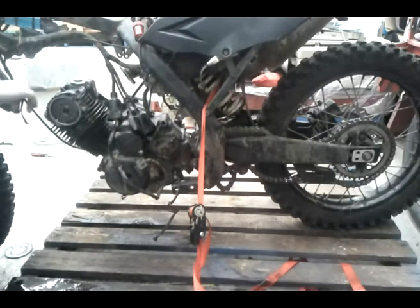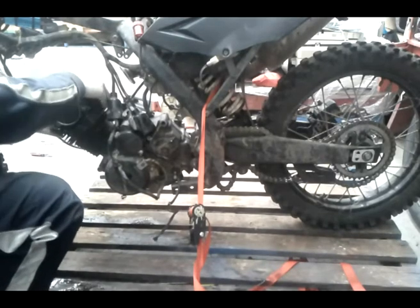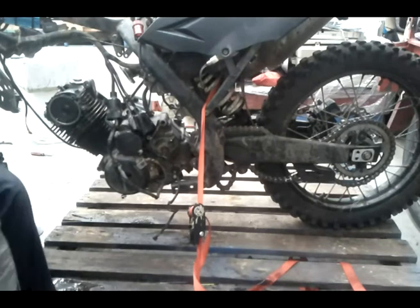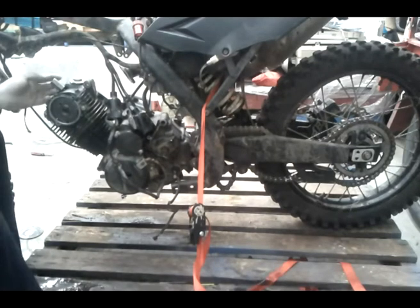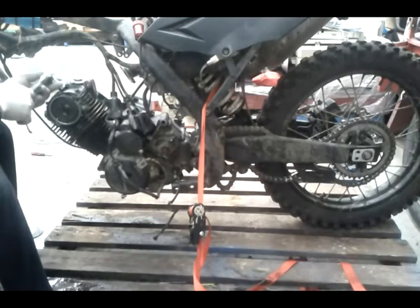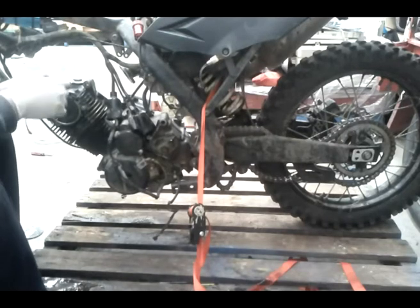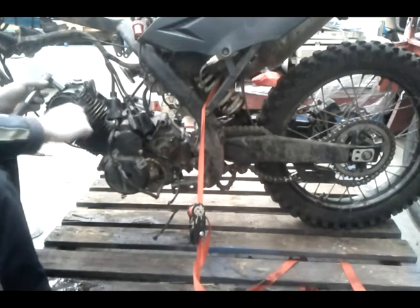Next, you do the head studs. I'm going to tighten them up. You want to tighten these down, but do it at your own risk. It says in my not manual, but I've read up to tighten these down to about 40, 50 newtons of torque. I went down to about 40 before the head stud ripped out completely out of the casing, engine casing.